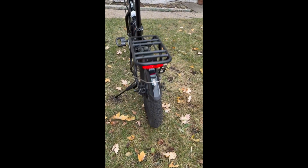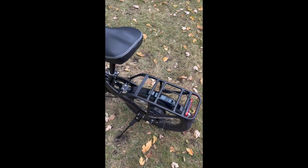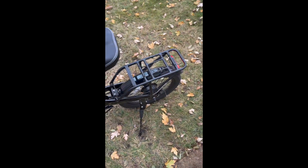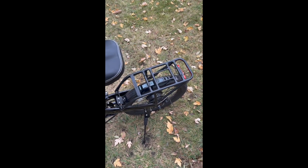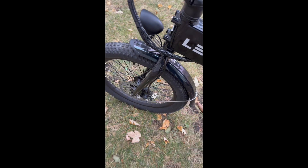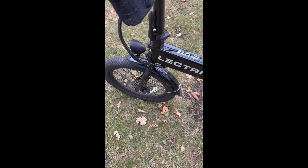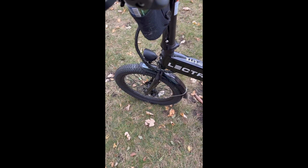There's the tail light — it's on. It's very cloudy and dark out because we're going to get some storms shortly. The rear rack and fenders are still working fantastic. I've ridden with them for over a week now. The front fender — the only thing that's a little problematic is you do have to bend these out occasionally, so check them before every ride because they can rub against the tires. I have the 2.6-inch tires that came with my bike; some people get 2.4.